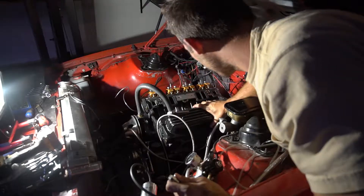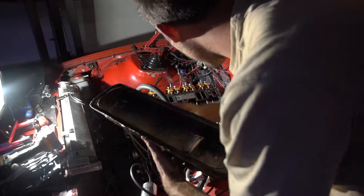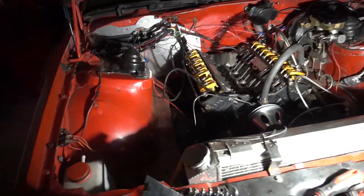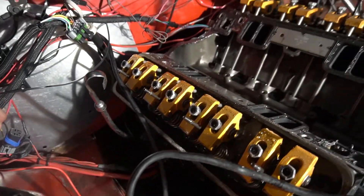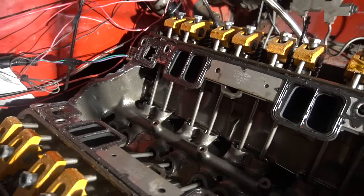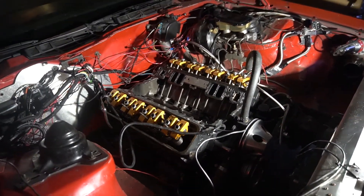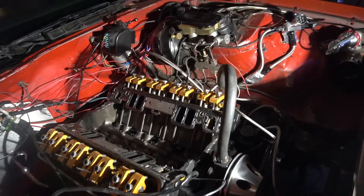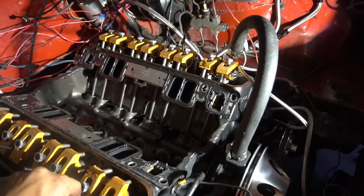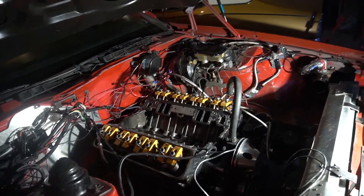Let's see how bad this side is. Ruined. Lovely. That's never cool. So both sides were pretty well milkshaked on both of the valve covers. The oil doesn't look that bad in there. That water, like I told you guys earlier, is from that water jacket. I'm really curious what it's going to look like once I take this head off. I guess I thought it might have only been cylinders 4 and 6, but if that one has it as well, then it's pretty safe to assume something went wrong over there too. So I'm going to start taking apart this valve train and checking it out.